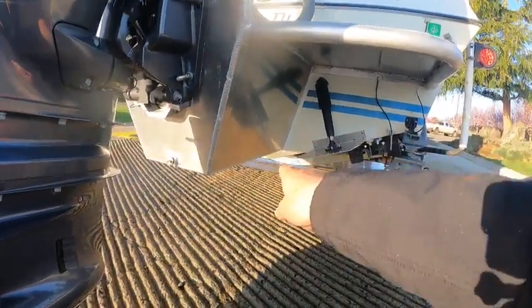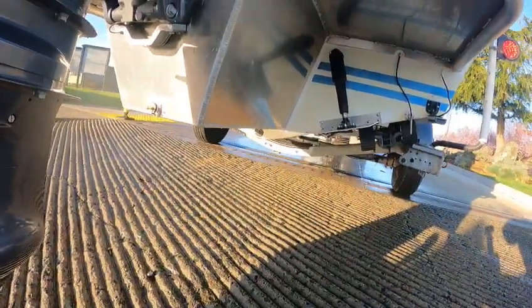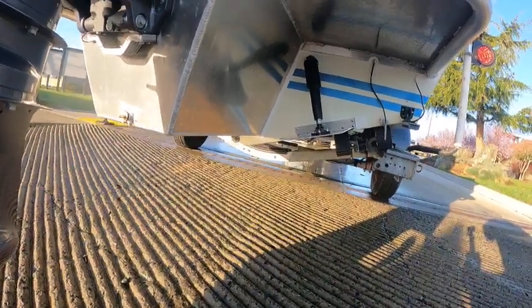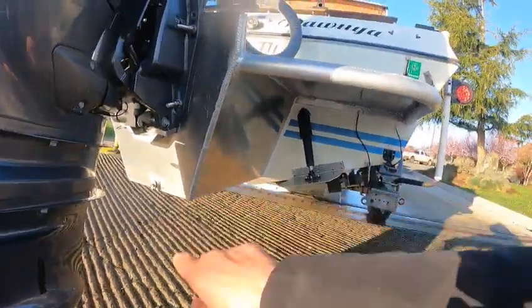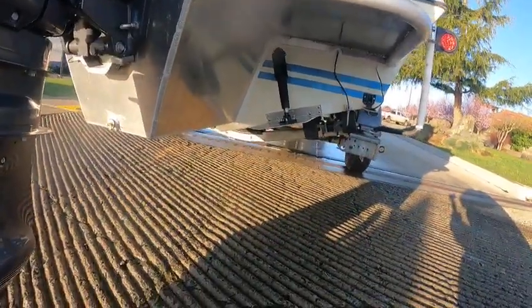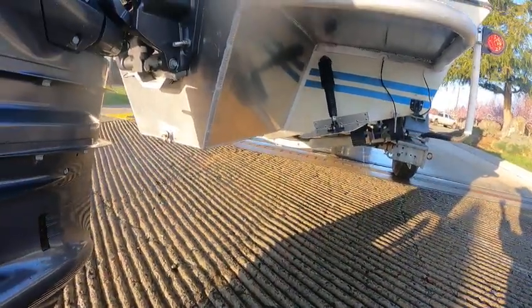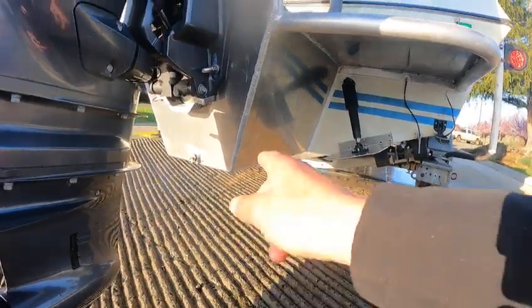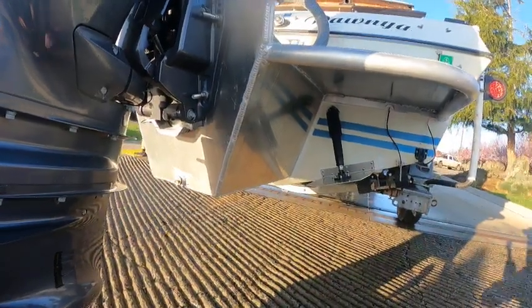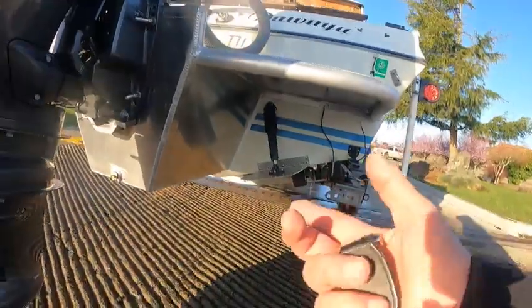To be honest with you, it should follow the same curve as the bottom of the boat. I know he's got a drain plug up underneath there, but that can be taken out — actually when you drop that out, kind of make that your main drain if you had to, or even drop that off and build a pipe in it so it drains out. I know what he was trying to do, but that ain't right. This should be extended out on each side — it should be straight, not at a curve — because that's just shooting that water right at the lower unit.